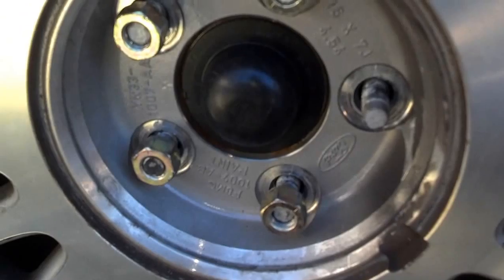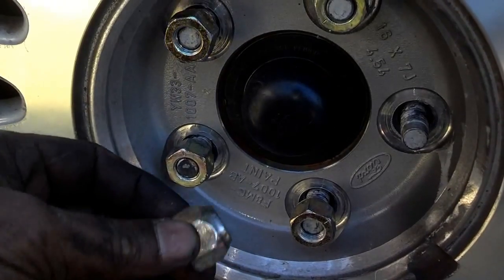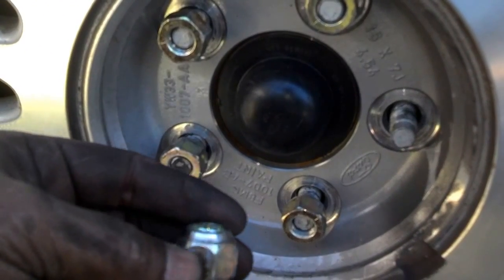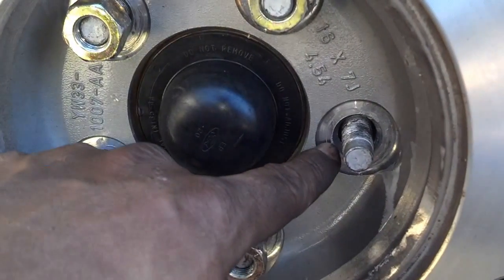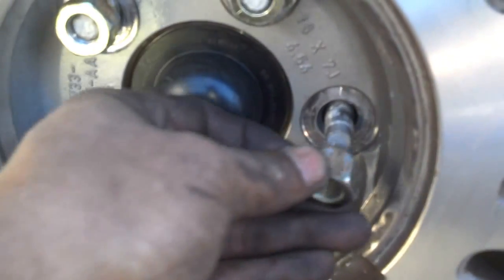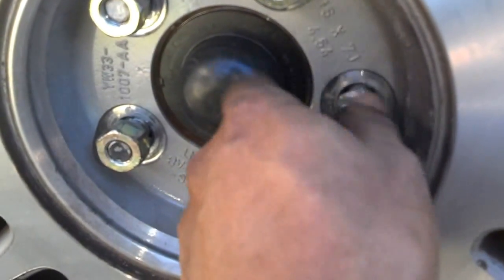Okay, I'm putting the wheel back on, which will hold the rotor in place tightly. And here you got the lug nut bolts. As you can see, this side of the bolt is flat. This side of the bolt has a nipple type on it. And on your wheels, you have a recess point. So you want to put these bolts in so that they point into the wheel, so they sit in the recess. Most people don't need me to say that, but just in case you do.